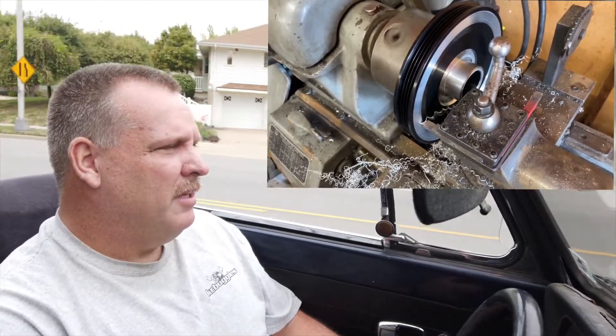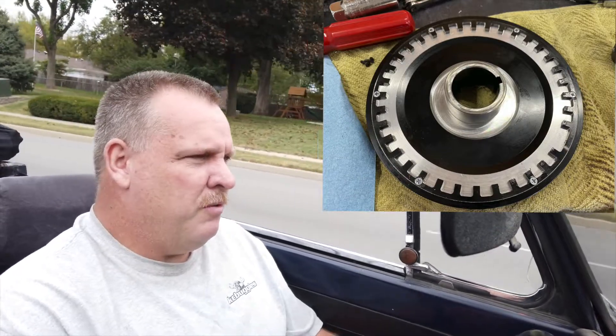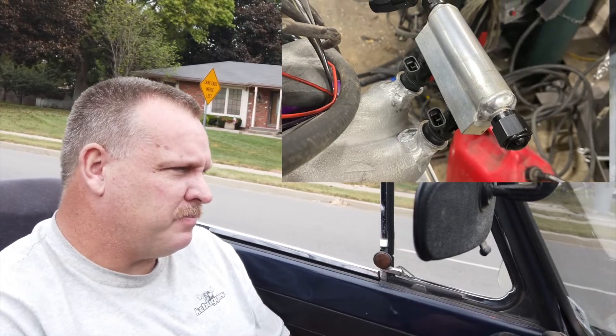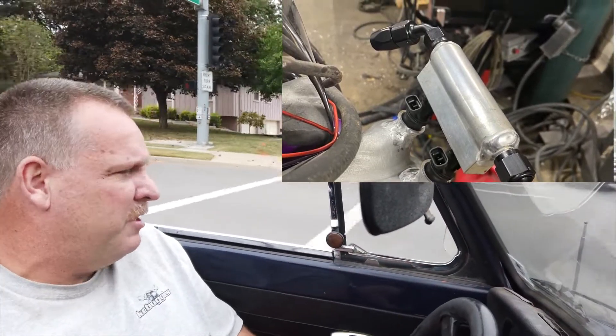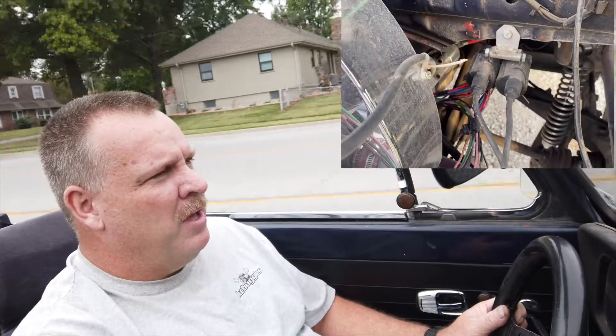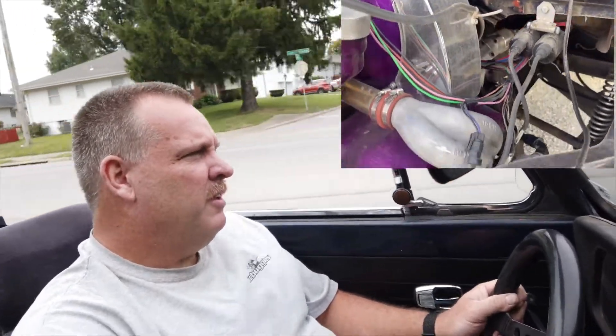I hooked that all up and then I had to figure out what I was going to do for fuel rails. I modified the intake castings to accept the fuel injectors, welding in fuel injector bungs, and built fuel rails to go on the end castings. I'm running 22 pound-an-hour LS2 fuel injectors along with LS2 ignition coils. I'm running four coils and wasted spark — batch fire and wasted spark at the moment. Since I have a two-channel board, it can't run a four-cylinder engine in sequential mode, but to me it works out beautifully. It's been really nice.